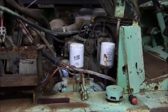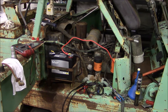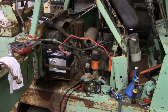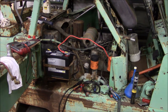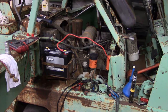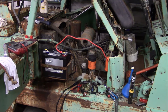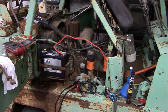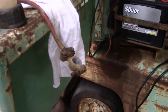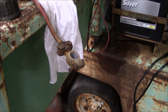There's a new battery, new battery cables, and I think we're almost ready to try to start this thing. Got new oil filters, new oil, filled the radiator with coolant, and flushed out the oil pan as best I could with some old fuel. Got all the sludge out I could.